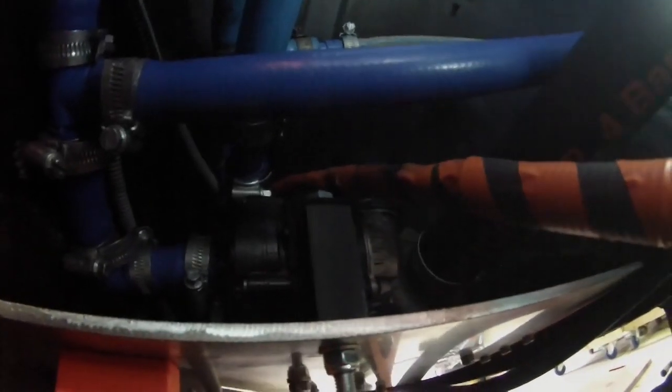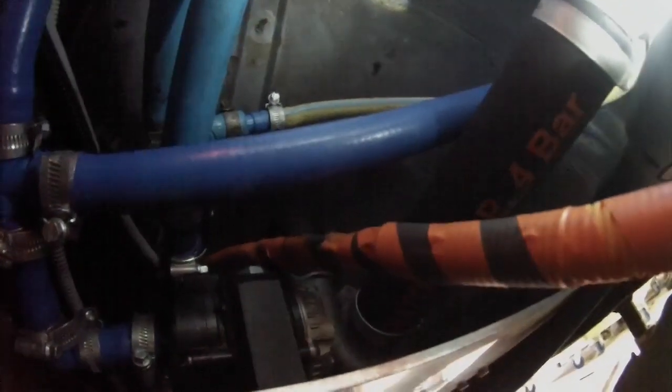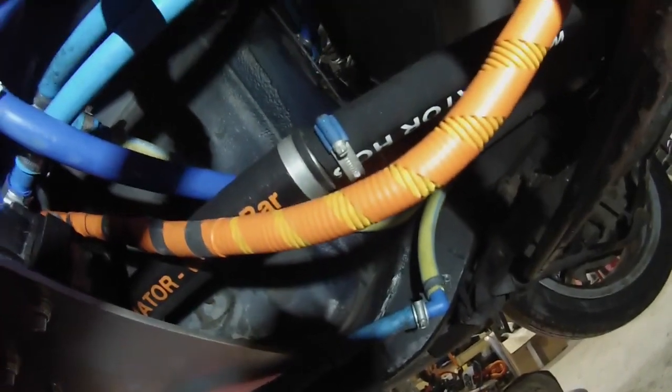Now we've, what's the name of it? A reservoir up the top and a bleeding line, or a bleeding loop I should say, in there as well. And then the big pump is in there for the drive unit cooling, and that's what that big hose, the big 38 millimeter hose here, is for. I'd like more light. So that's the 38 millimeter hose. It then has a steel adapter that I machined actually, bringing it down to 28.